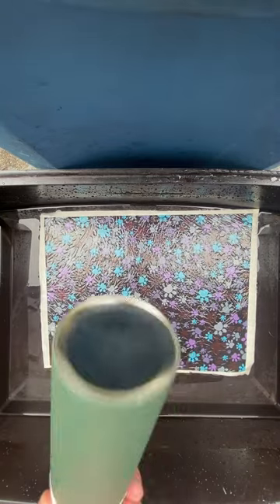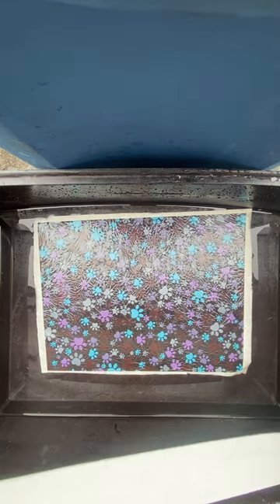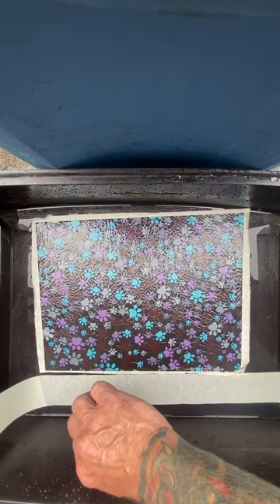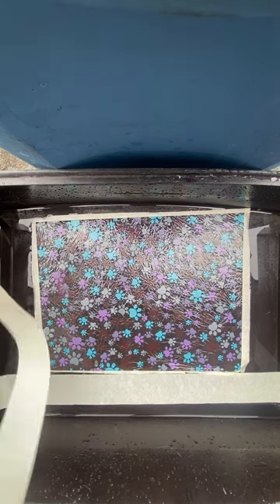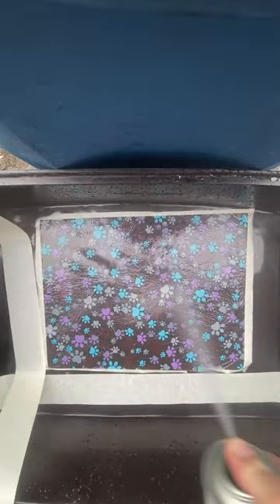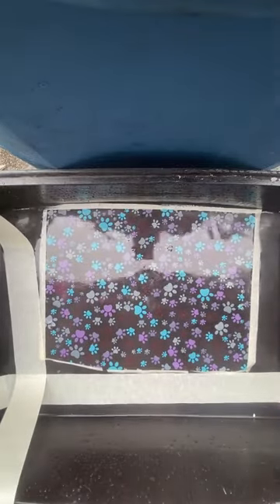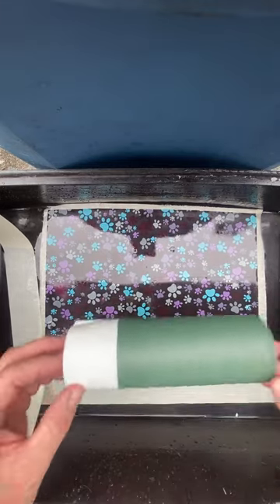Next I'm going to come through with my activator. I'm going to do a nice light pass from left to right and then again from top to bottom. I'm also throwing in some extra tape to border off this film a little bit more, to hold it in place, because once I activate it it's going to start to spread — you'll see it start expanding even with the tape in place. I wanted that thin extra border so it doesn't get too carried away on me. You can see the film activating, expanding, and it's glossed over very nicely — it looks like paint floating on top of water.